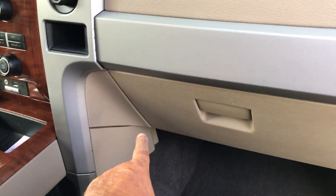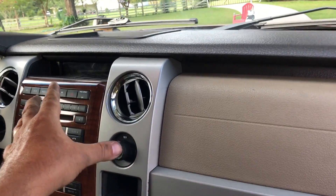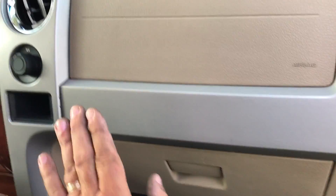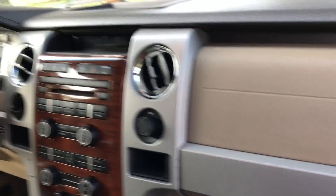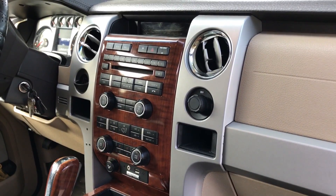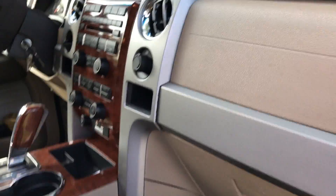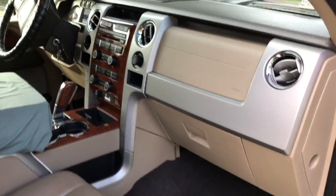If the bottom one goes out it's $1,200 to replace it — the whole dashboard has to come out. I replaced the top one and figured out a way to get to it without pulling the complete dashboard apart. I pulled this apart, took the glove box out, and went up with my very large hand to the blend door and managed to get it in there. I actually have a video of that — maybe I'll start a Ford repair playlist. The blend door actuators go out way too often and they're very expensive at the dealer, but the part itself is about $30 on Amazon.